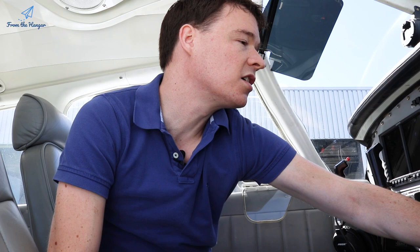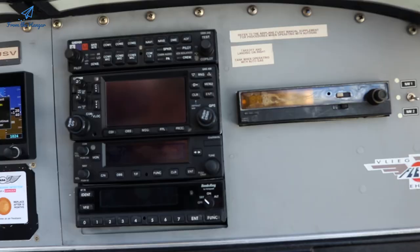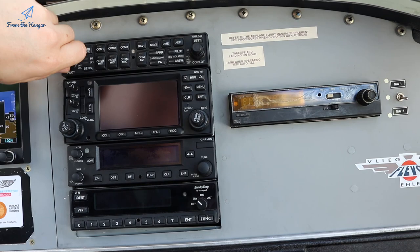We check first that the magnetos are off. Check that all the switches are off — nav light switch off, all are off. We check that all the circuit breakers underneath are all in. Check the mixture is off. In some planes you have a button to turn off all the avionics; this one doesn't, so we turn off all the equipment separately on shutdown and check all the other buttons are off.